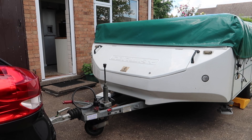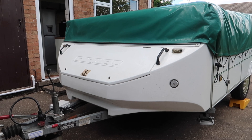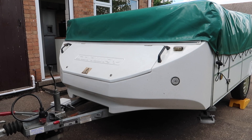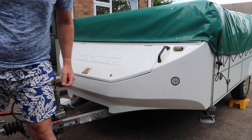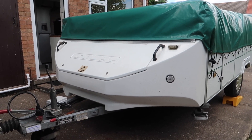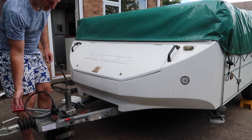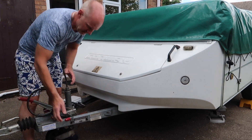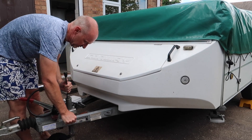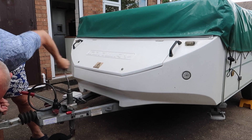What I'm doing here is pulling the trailer onto two ramps, which is not really what you would normally do, but I'm demonstrating from an extreme. I'm pulling the trailer onto the ramps, and I'm going to put the handbrake on two clicks because I know that will hold it in the forward direction. I'm going to put the jockey wheel down and put the handbrake on two clicks — that will normally make you think the brakes are on. I'm going to wind it up and drop it off the car.